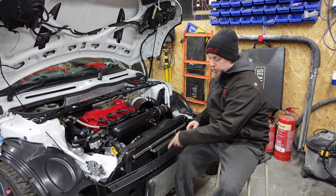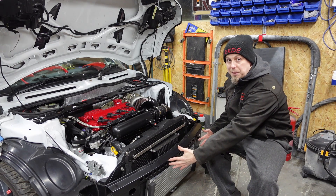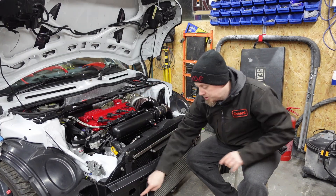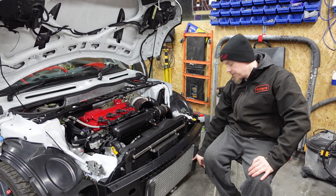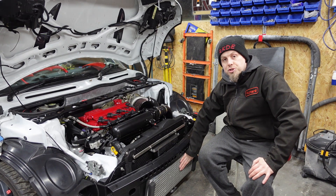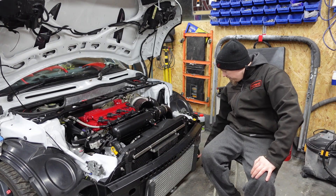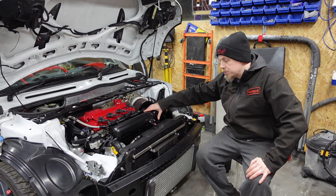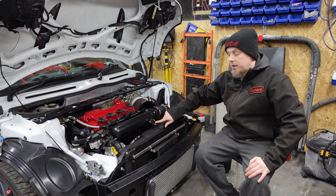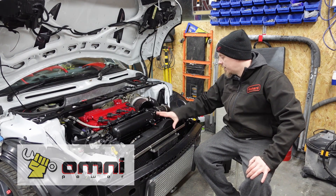This bar runs across on the original air conditioning brackets. Down here I've got my oil cooler which runs down to a thermostat and goes to the side of the engine. On the front of the car we've got a plate-and-bar intercooler. The pipework comes from the turbo, round and down into the intercooler cross-path. Plate-and-bar intercoolers have good turbulators so heat rejection is quite good. Coming out of there it goes up into my inlet manifold — this is a modified unit, originally made by GRS — running the three-bar MAP sensor available from OMNI.